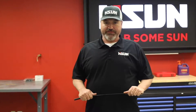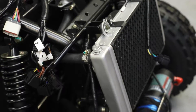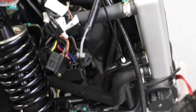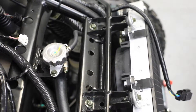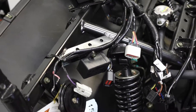So we're going to start on the Sector. It's already torn down - we have the majority of the body off. We're going to run front to back on this unit. At the very front we have the radiator. Everybody knows what the radiator does and where it's at, but we get asked about the thermal switch. This is where you're testing your cooling fans, at the thermal switch. Your cooling fans are obviously on the back side of the radiator. Also underneath the cowl here we have things like the winch solenoid, the speed limiter, and the buzzers.